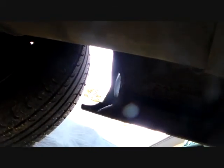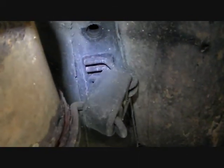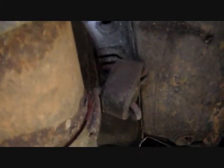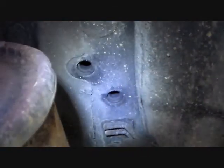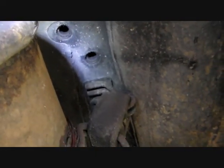You might want to go ahead and also drop this buffer clamp. Now, you've got on this thing a bolt or two. You've got one bolt over here that holds this one on and another one that's over here — there's two over on this side. I wouldn't bother trying to take that off because the clamp's rusty and that's a fight I don't want to have. So you may want to do the loosening and removing of the bolts out of this exhaust stuff in concert with taking this back part off. Those are the two bolts you're going to use — two on each side — right there kind of above the muffler. That's why the muffler probably needs to be dropped a little bit out of the way.